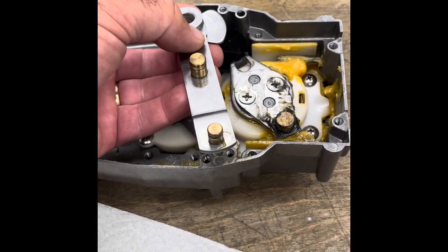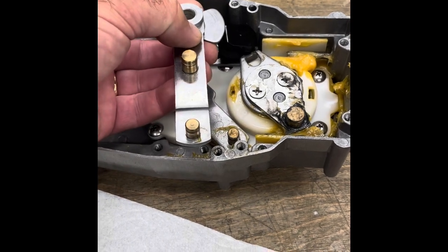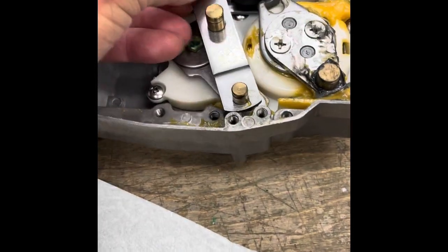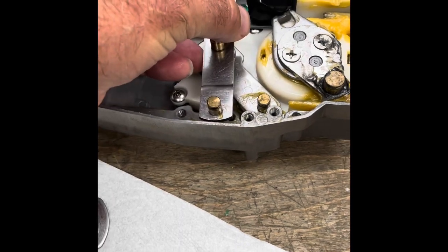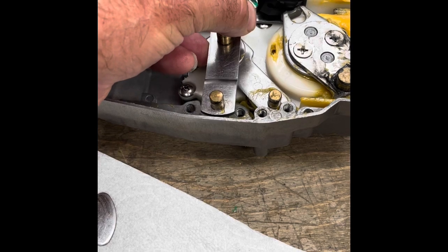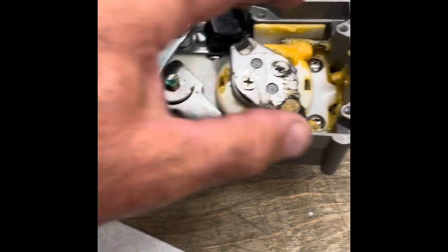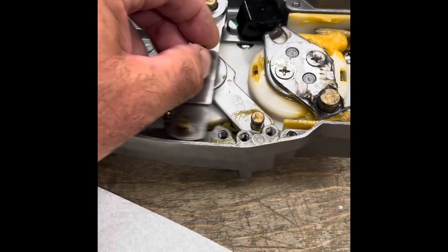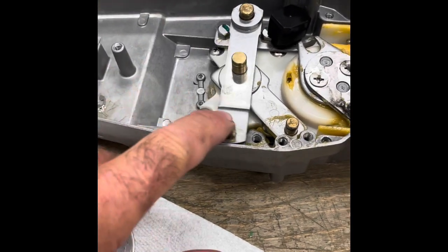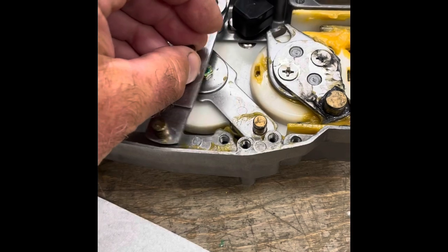When you add throttle, the friction is going to keep it right where it is. Right now, when you add throttle and you let go, if you measured out here, I would move it and the spring pulls it forward — there's that much slop just between this and that. The cable, the linkage, and the connection to the mechanism that slides and pushes on this right here — that is slopless. It is so perfectly precision tight. There's no slop in the bearing, no slop at the cable connection. Everything is very, very tight. It's just a shame they designed this particular interface to not be so tight, because that's where you get all the movement when you let go of the throttle.